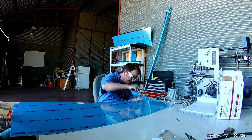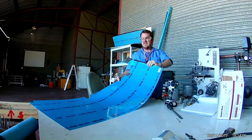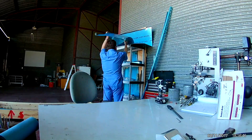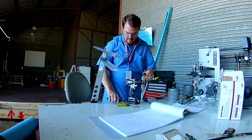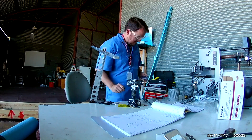So you have to cut a little bit. There are two rudder skins and they have an overlapping piece in the front that goes around the two ribs that hold the counterweight in place. One needs to get snipped, and I actually did it with the aluminum snips and didn't mess it up. And those are the two ribs where the counterweight sits in between.